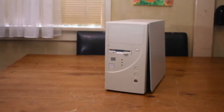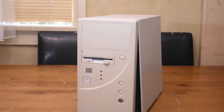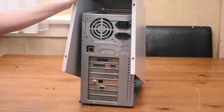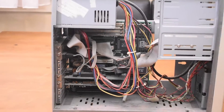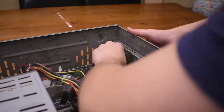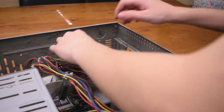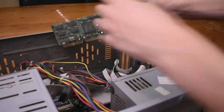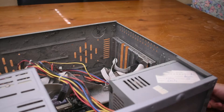Now let's move on to this PC, which has a different case design and a turbo button as well as an LCD display — so hopefully there's something better in this one. There is indeed something different in this system. Anyway, let's unscrew all the expansion cards. The first thing we have is another ISA network card — I'm beginning to think all these systems were used in some kind of terminal array. Next we have a standard ISA VGA card, and that's all the cards in this system.